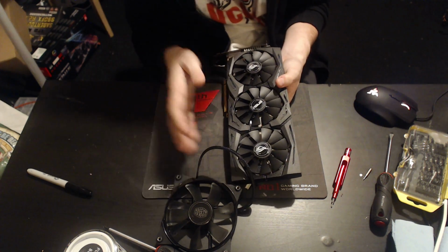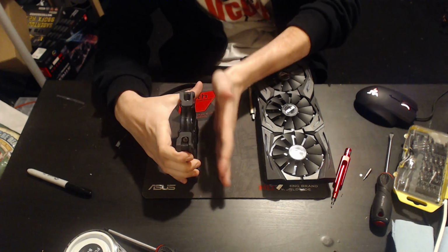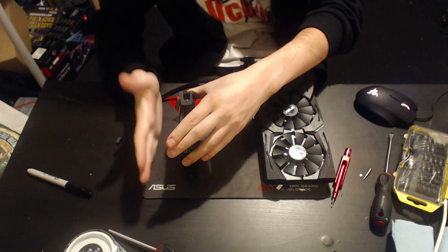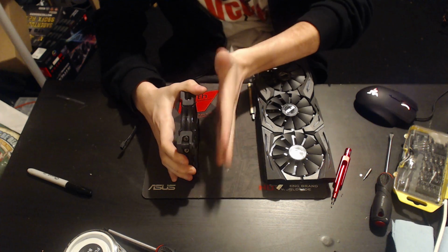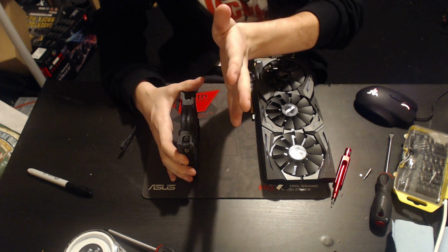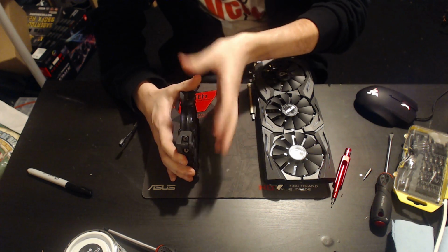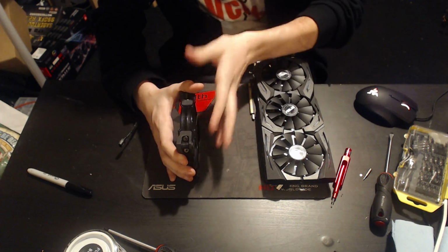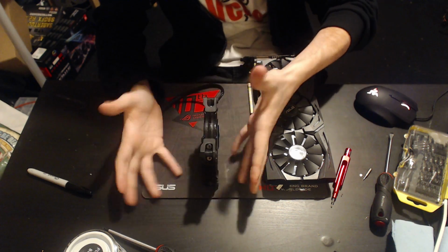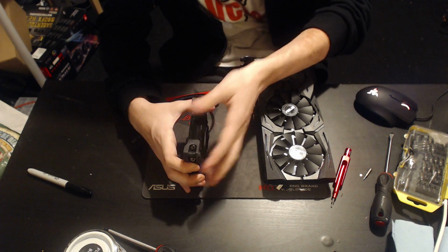If you have a pull fan, if you look at the pressure, the amount of negative pressure you get in front of a fan compared to the amount of positive pressure, very big difference. Here you have a lot of positive pressure. The amount of negative pressure you get with a fan is kind of crap, which is why you don't do radiator pull setups. No, you don't run those if you want optimal temperature performance. You run pull if you can't do push-pull. Just generally, fans are kind of bad at pulling. It's really hard to optimize a fan design to pull well.